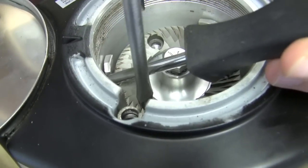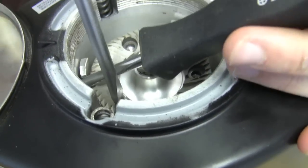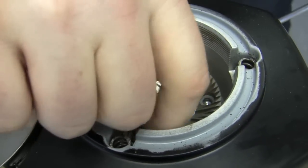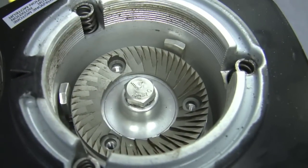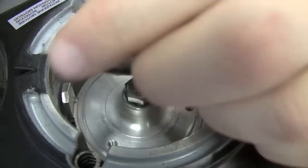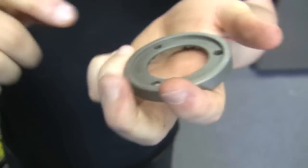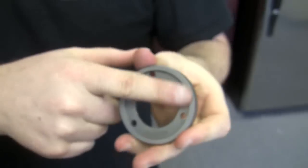You want to be careful not to get overly excessive. General rule of thumb is there's no such thing as too much cleaning. But when we're dealing with screws, if we start taking these in and out every two weeks, you're going to eventually strip something. I like to take them out because now we can get underneath here and get anything that ends up there. You can see they're relatively clean here, but you can actually get any of the gunk that's underneath — there may be some coffee oil buildup. You're going to have oils and regular grinds underneath there. It may sound minor, but just a little bit underneath can start affecting consistency.